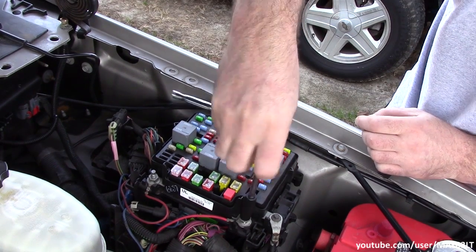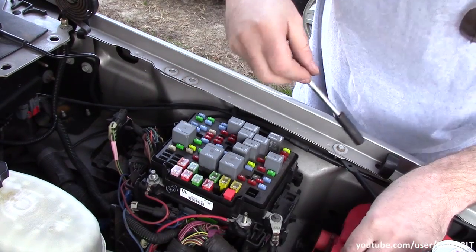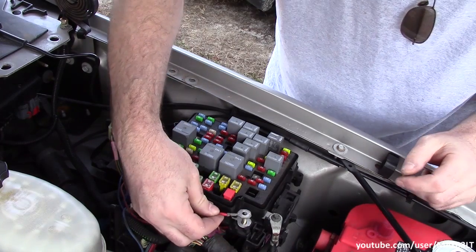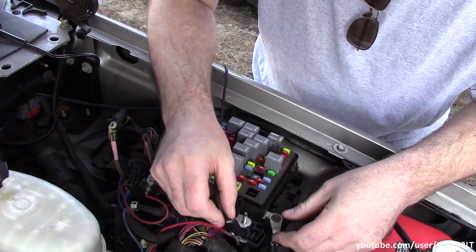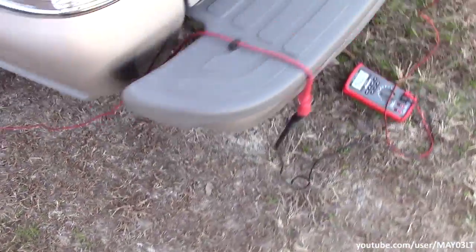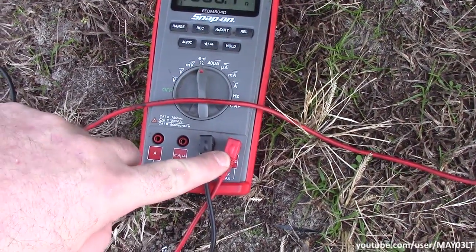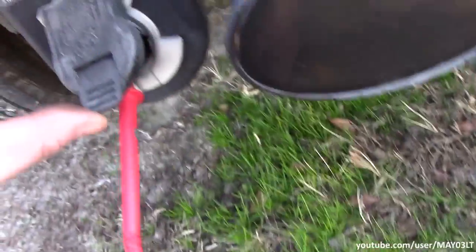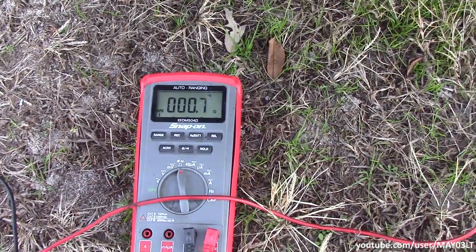This is a 10 mil. Take that long jumper lead and just clip it on that guy — there's the jumper wire. Jump wire goes into the meter, the other lead of the meter, right at that pin right there. So we know that wire up there at the fuse block is the wire that comes here.